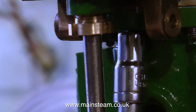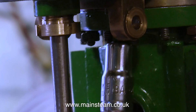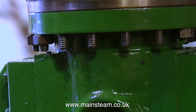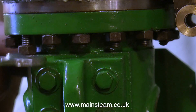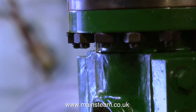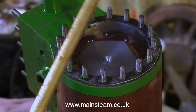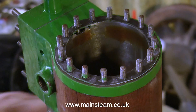The other bit of good news is that you can also start the nuts onto the studs just by using the socket. All you do is put another nut down in the bottom of the socket, then place the nut you want to use on top of that, and it's plain sailing. The job satisfaction varies — it really depends how good the engine is. If I'm working on a really bad engine I find it tedious, but if the engine is basically okay, or like the Stuart Major Beam engine, really good, it was a pleasure. This one's so-so; it's not brilliantly made, but it will turn out to be a very good steam engine.